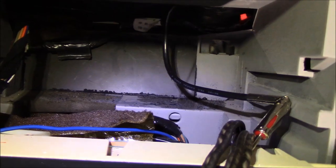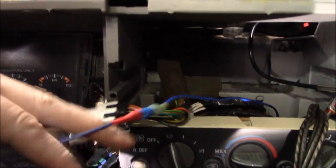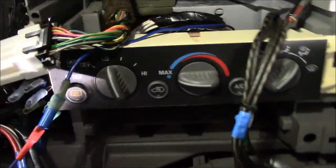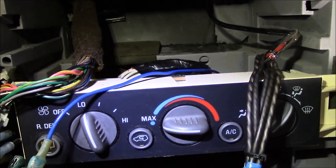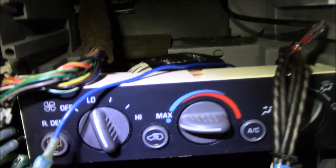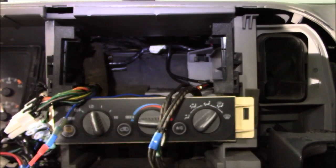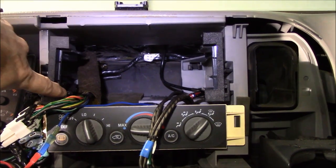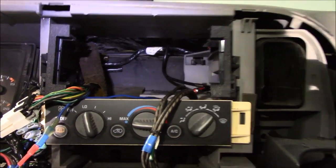The harness is integrated — there's the remote turn-on, using a butt connector in case I want to take it out again. Tucking the antenna up in there as far as I can, tucking all the stuff as far as I can. I'm still going to use that bracket somehow — this may be a harebrained idea but I have a habit of making harebrained ideas work. Getting the bracketry in here and pulling it out to the side may give me the support I need, tying it into the structure of the dash instead of just hanging on the dash fascia.